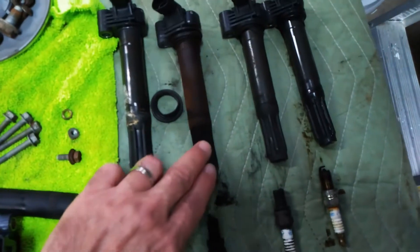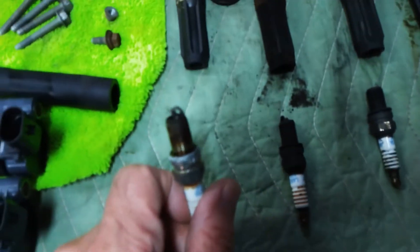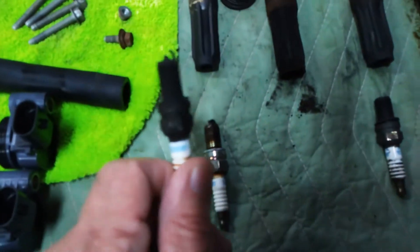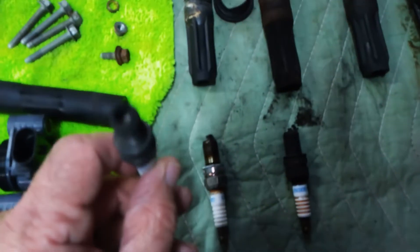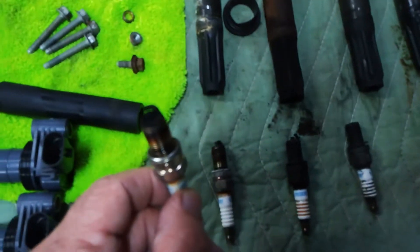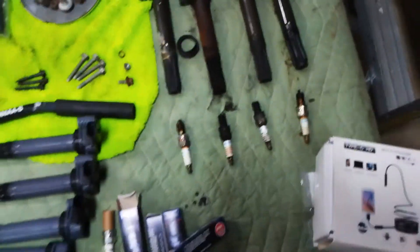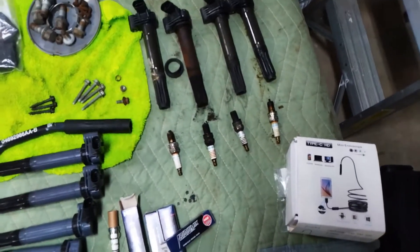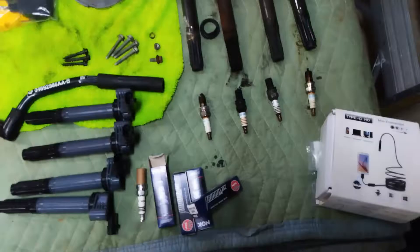As you can see, there's plenty of corrosion and rust, with oil on plug number one — almost touching. Plug number two is totally burned out. Plug number three is totally missing — no pin, nothing. Plug number four is pretty much normal, a little rich. Believe it or not, the car was actually running and had power. We were totally surprised. When we took the plugs out, two and three were both loose — two was exceptionally loose, unbelievably so.